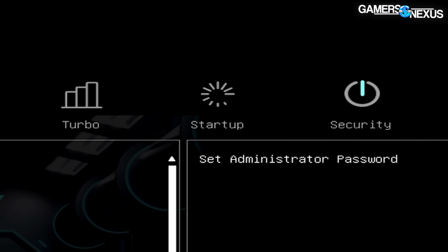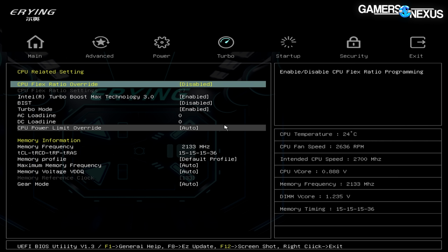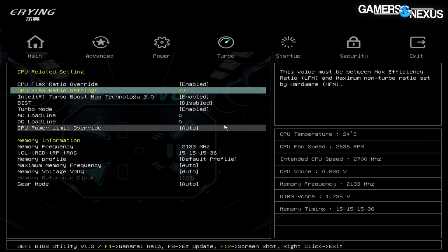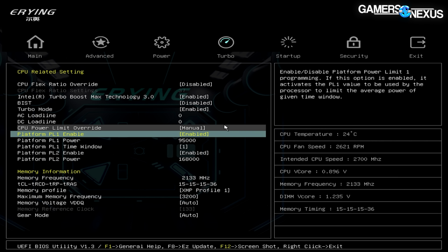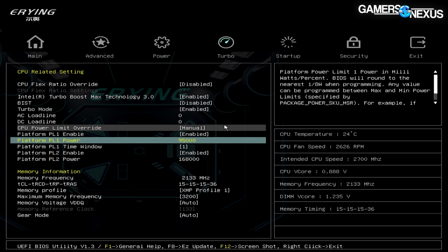You get the idea. Since the 12700H is a locked CPU, the turbo menu doesn't do very much. You can set a custom core ratio between base and boost, which is normal. You're also able to set a custom set of power limits and duration, all the way up to 999 watts. We went in and checked hardware info after setting these, and yes, they applied.